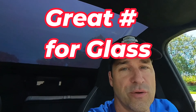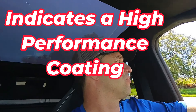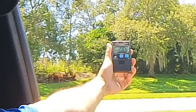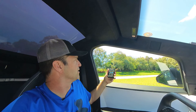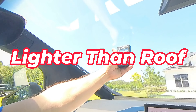There's only 20 BTUs per square foot coming through — that is a great number in the window film industry. When applying a film to glass, if you can get it down to 20, that's amazing. We've got right around 286 — let's call it 280 BTUs transmitting with no glass. And then on the side, there is a slight tint. The side windows are down to 43%, but that's on an angle. Now let's check the windshield — it has a lighter tint and it's down to 42.